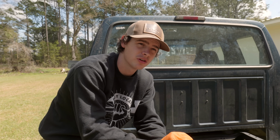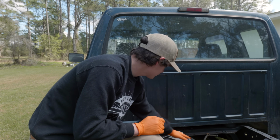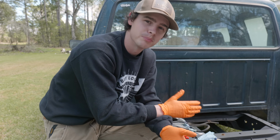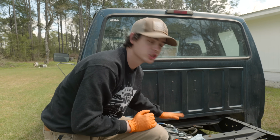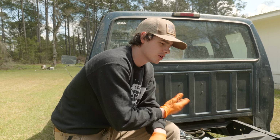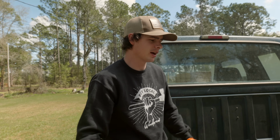But apparently it's a bigger deal than it sounds, because it can start overflowing this tank, which I didn't think about. There's a vent tube here, which vents out any sort of pressure buildup in your tank. Obviously that's very important, so that you don't have a bomb sitting on your truck. In the worst case scenario, say a fire or something, this whole plug can just pop out, and there's a large hole for energy to expel through. So you never want to have a closed system on something like that. Regardless, if it fills the tank up too much, it'll just start pouring out of the overflow in the vent tube. So it's a good thing that we found this early, and again, thank you very much to everyone who brought that to our attention. I was completely unaware that was what was going on. It just was not in the world of where my brain was at.